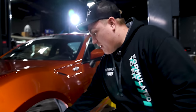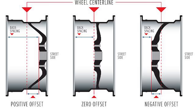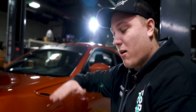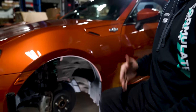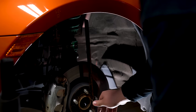The first thing you're gonna wanna do if you're looking at measuring for your wheels is find your backspacing. Now your backspacing is gonna be the measurement from the front of your mounting surface — this is where the back pad, the mounting pad of your wheel, is going to mount to your car. This surface right here is gonna be our main reference point for pretty much all of this. It's a flat surface; this is where the wheel mounts to and where the offset is dictated from. What we're gonna do is take a nice straight edge here. You're gonna wanna compress your strut or suspension components up to where it would be with the car on the ground.